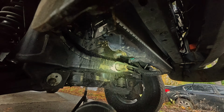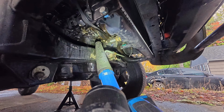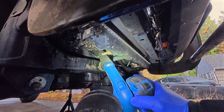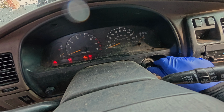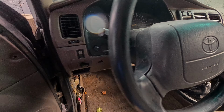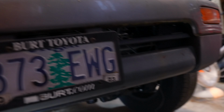So you want to do the same steps over. Spray it with brake cleaner, then get the leaf blower and completely dry it off and run the engine. Remember, the fan is also pushing air and could be pushing the oil and the old brake cleaner around. The Exxon Valdez has been sitting in here for a couple days. Check it out. All I need to do is look directly up where that oil leak is, and that is the volcanic leak in the Exxon Valdez.